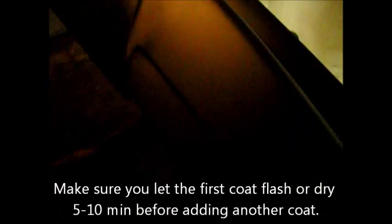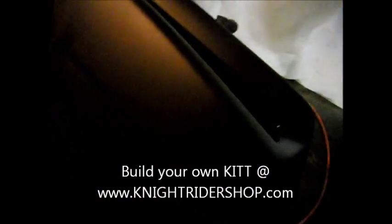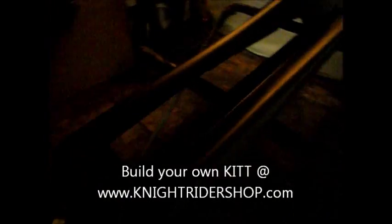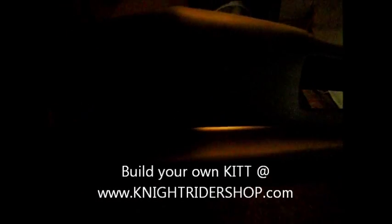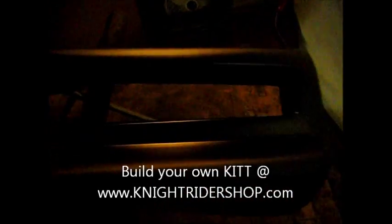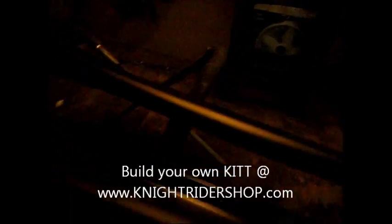Alright, there it is. Bumper's nice and primered. I put 3 layers on it. First one was a light mist, and then 2 medium coats. Now we'll let it dry overnight because it's only about 65 degrees in here, and I don't have a heater in here. Primer's supposed to dry in about an hour on a warm day, but it's cooler, so I don't mind waiting another day for it to dry before I touch it.